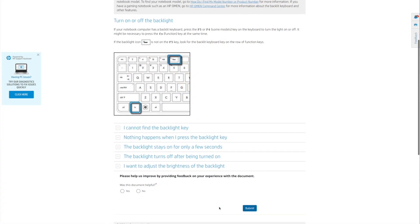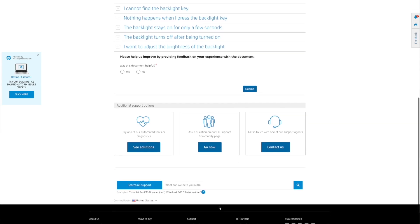For the backlight, if you experience issues you can press F4 or F5 depending on your model to turn it on or off. On some models you may need to press the Function key along with F4 or F5. The unfortunate part is the backlight only stays on for a few seconds, so you may need to reset the timer. You can go into your system settings and change the backlight timeout function, which is located in the BIOS — the Basic Input and Output System. I'll attach directions in the description.